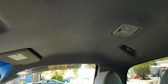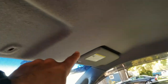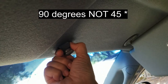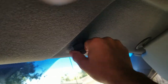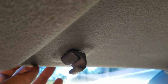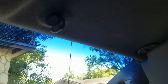So to be able to fix that, I'm going to remove the headliner. But what you need to do to be able to remove the headliner is, of course, remove the sun visors — turn it 90 degrees. Actually, 45. The only thing that has little clips, the yellow clips, which I don't want to break.